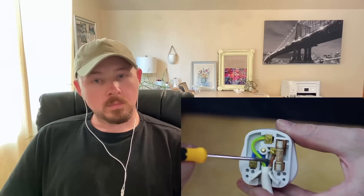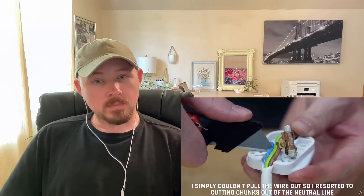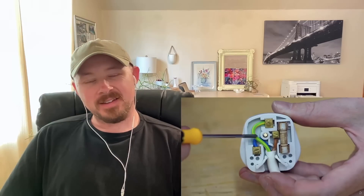Speaking of plugs being ripped out of the wall, that brings us to feature number seven. If we open this up and take a look inside, you'll actually see some pretty cool safety features built right inside. There is built-in strain relief right here, and you can actually remove these little fins in many cases to replace this cord if you need to. The brown live cable in here is the shortest and straightest one, so that as you pull this cord out, that one is going to be the first to disconnect, cutting the electricity. The neutral is underneath and will get pulled out next — at that point you have no electricity, just your ground. It's brilliant that there's extra slack built into the ground, a little in the neutral, and no slack built into the live. If this gets ripped out, it pulls the electricity first, keeping the user safe.